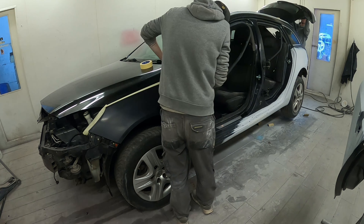We're going to blend the wing, probably front and rear edges, keeping away from the bonnet so we've got a nice blend to the bumper that'll be fitting up to it and the new door from this side. We've also got the second-hand doors — all sanded, prepped, masked, and hung on stands ready. There's a little bit of primer down by the area where I'm repairing one door, and a tiny little dent on the corner that I've sorted. They're ready to paint.